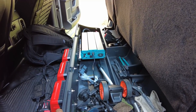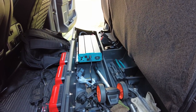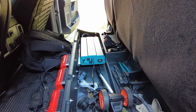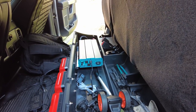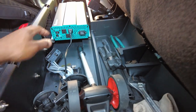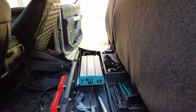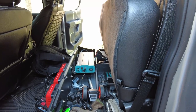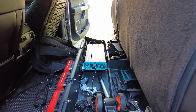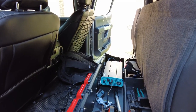If I were doing this for a customer's vehicle, I wouldn't do it this way. For my other work truck where other guys are using it, I wouldn't run it over capacity like this. If I were doing my other truck I wouldn't go more than 2000 watts — maybe even 1500 watts — and I'd still use 4/0 wire, but marine grade wire unless I can get real close to the battery.